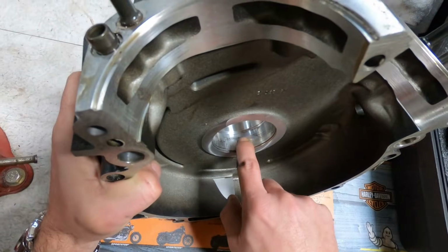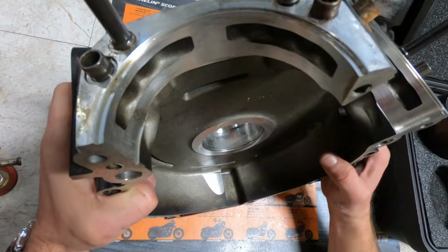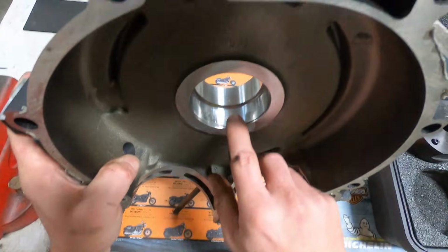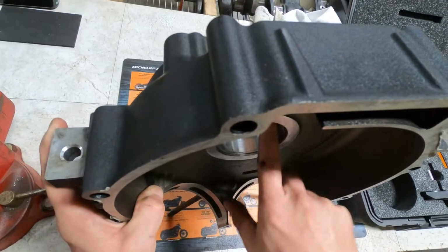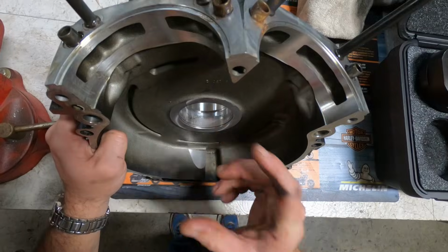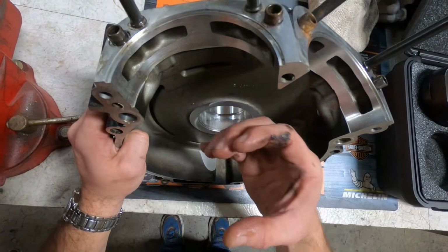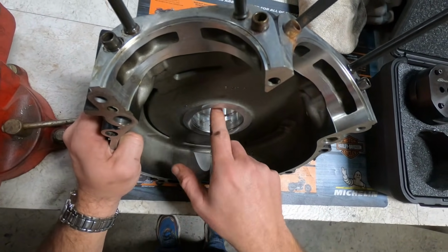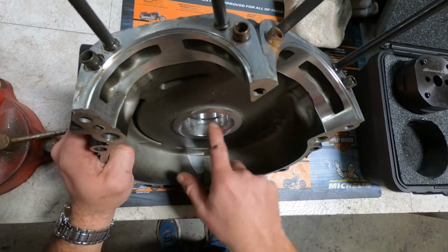Notice here, you see that same exact heat signature and wear pattern. Now let's rotate it around and look at the top. You don't see it as much. There in the top, it almost looks like raw machined aluminum. So all of your forces are down here. With that tapered Timken bearing, you're spreading these forces more equally between two bearings along the entire surface because it's a taper, instead of just focusing all of that pressure on one side of the bearing.